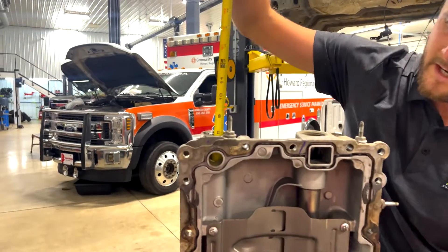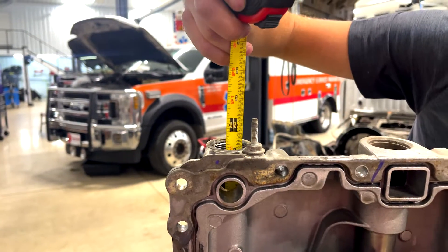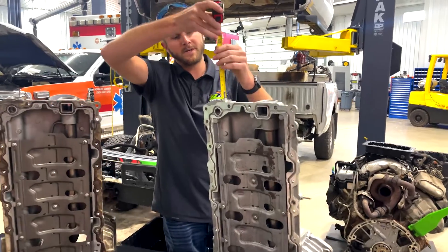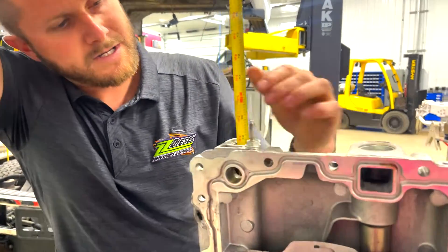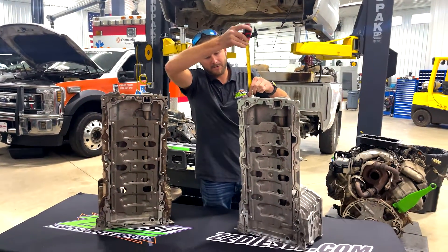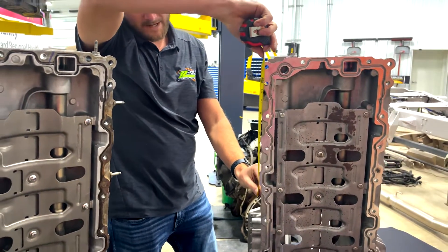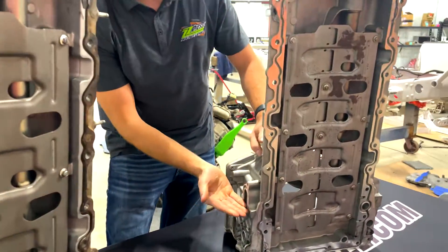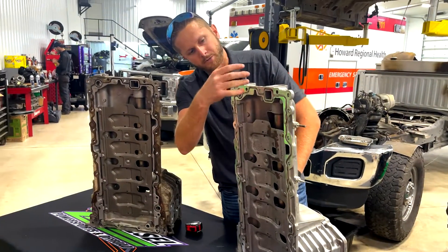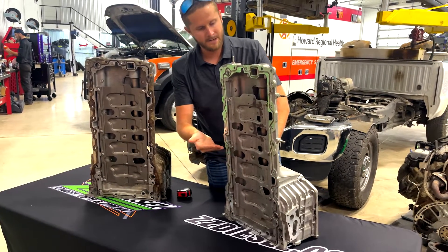On the original oil pan that came out of this truck, I'm going to use a tape measure. As you can see, I can go down almost 23 inches before I hit the bottom, where there's actually a plug put in after the pan is bored from the factory — so that one is at 23 inches. This brand new upper oil pan — I am only 14 inches in and hitting the bottom right now. That's only roughly this far down. Here's where your oil cooler is at. The oil pickup tube comes through, through your low-pressure oil pump, down this tube — and it's supposed to go to the oil cooler, but it's now dead-headed in this brand new oil pan from Ford.